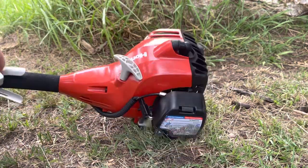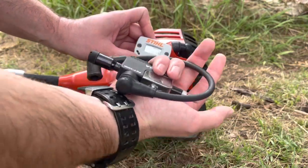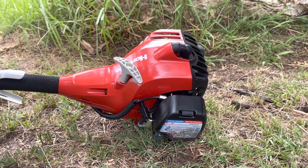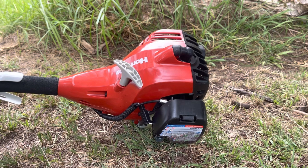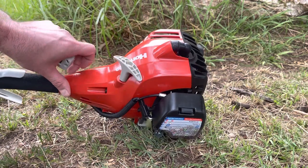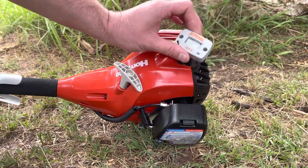The issue is that this HT lead has lots of insulation around it and that's what's restricting me from getting a good reading. Whereas this wire doesn't - the wire actually runs very close to the housing, it runs along here, down here, and then at this point it goes down to the coil. It's not miles away, it's just very insulated. This actually has rubber insulation and also a mesh wire insulation as well, which can make it tricky. Having just a plain wire, you can hold the tachometer about eight inches away for this one.